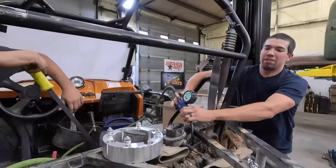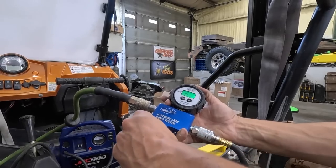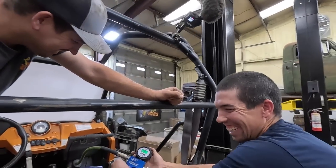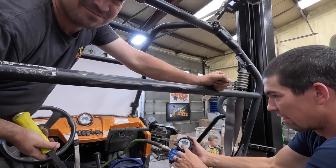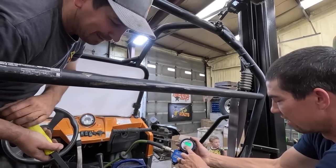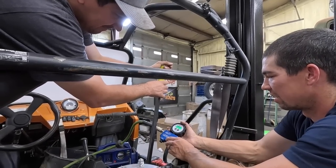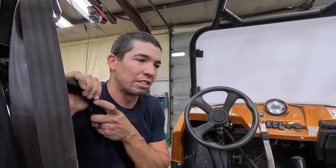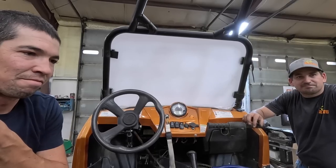All right, Sean turn it. That means that one's good. He's good at breaking it. It feels like it's good - I can see you struggling to hold it, it's bending the bar. I think it's just too much air pressure in, is what it's saying. We had good tests on the leak down so I don't think there's any issues with the top end. The valves are sealing good. Still don't know what the clunk is.